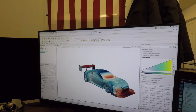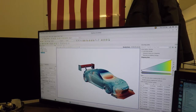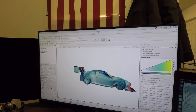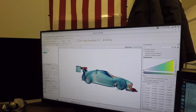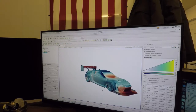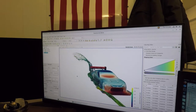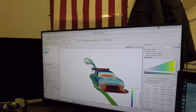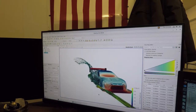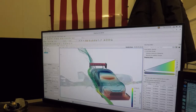The splitter is used to balance out the rear wing - the rear wing makes a lot of downforce, and you can see our data for the single element. The dual element is even better. Our single element is 300 millimeter chord; the second element is 200 millimeters. It's a big wing that makes a lot of downforce and is pretty efficient. This is why you want to vent the fenders as much as you can with that high pressure - but we're stuck with the constraints of this build. Looking at streamlines, you can see spillage over the end plate. The end plate helps keep low pressure on the bottom and high pressure on the top, making it more efficient.